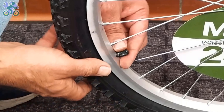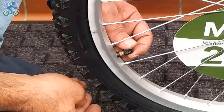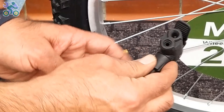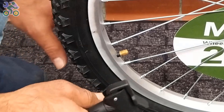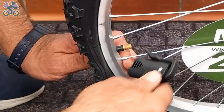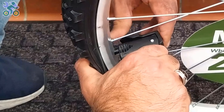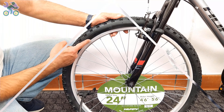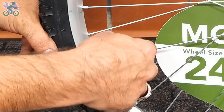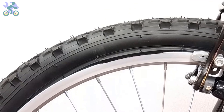To inflate the tire, first remove the valve cap and put the air pump head on it. Sometimes this is difficult because pressing the tube valve causes it to go inside. If the tire is slightly inflated, first deflate it completely. Press your thumb on the back of the valve and place the air pump head on it. Inflate the tire halfway and make sure the tire is still on the rim. If part of the tire pops out, release some air pressure, put the popped-out area back inside the rim, and reinflate.